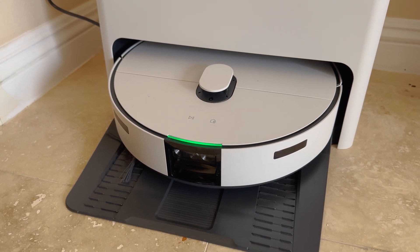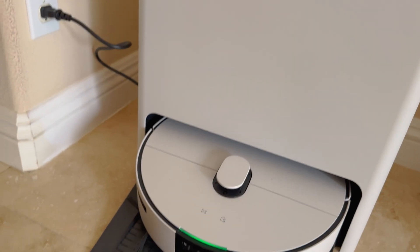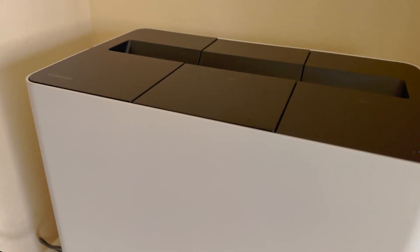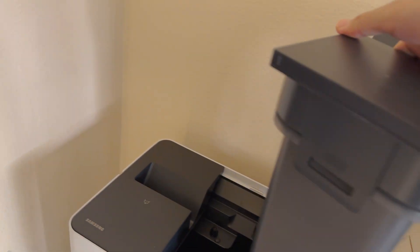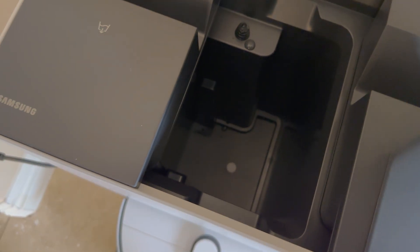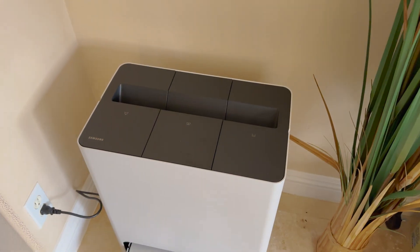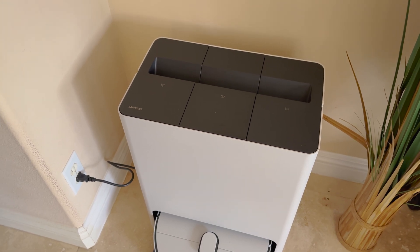We'll also help you troubleshoot a nuance: originally when I unpacked this, the clean water tank was not detectable because a sensor magnet had fallen out of one of the grooves. The clean water tank has a little magnet right down there, and this magnet can slide out the bottom of this tank. That little round magnet, if it's not secure, can sometimes fall into the bottom of the tank — and that's where I found it. Without that magnet, the sensor didn't recognize it. I shoved it back in and now it works again.